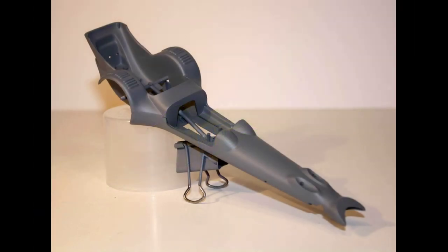Well, when you've removed all the blemishes and done all your pre-work, you can go ahead and give your vehicle body a complete coat of etching primer to make sure that it's got a good bite for the finish paints.